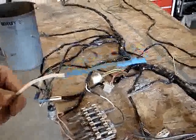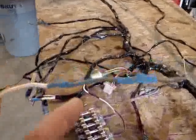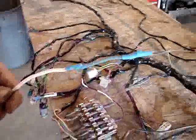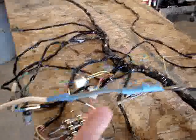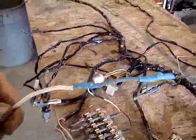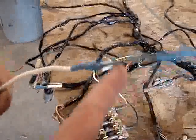We typically put a piece of fusible link on the end — that's the key, and it was missing. Fusible link is really important: if there's a deficit in the harness where it suddenly grounds out or too much current is going through, this link right here will melt. A lot of guys don't know about this and just hardwire it, but this fusible link is really key.